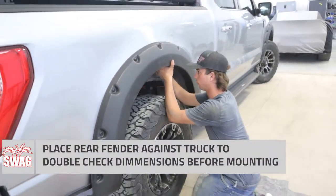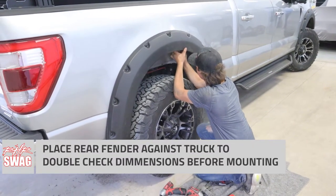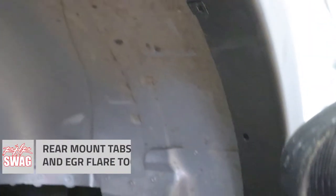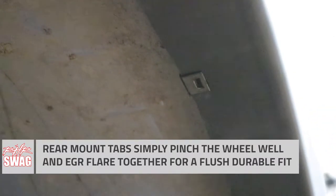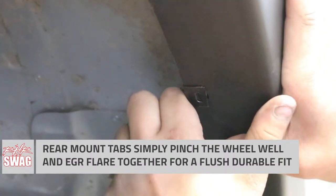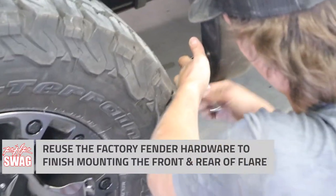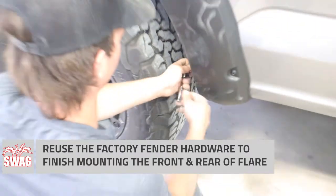It's a good idea — we don't show it in this video — but before you actually start installing your fender flares, mock them up on the vehicle using some sort of tape. This helps you visualize the final fitment and if there are any discrepancies with the fender flare, it gives you a chance to catch it before you start installing. The rear clips work pretty slick as well. They pinch the factory metal to your fender flare using the quick clip system and slide into the slot. Just like the front, the front and rear portions of this fender flare reinstall utilizing those factory hex bolts.